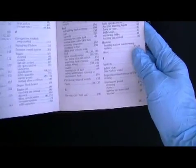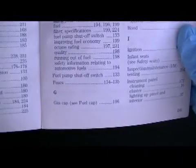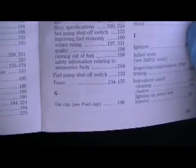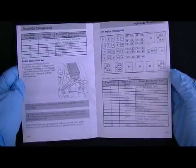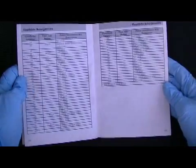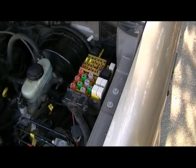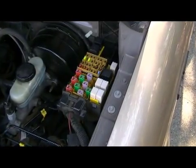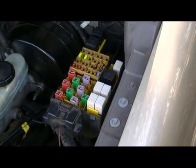Here you can see the fuses are covered on pages 134 to 135. The power distribution center usually always follows the section on fuses, so it's not necessary to look it up separately. Pages 138 to 144 show the location of the power distribution center and list the fuses. None of the power distribution center fuses are applicable in this case. However, if you are using in-car power or adding a booster pack to the battery, it is always a good idea to take a look at its condition prior to attempting to image the ACM.